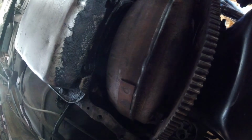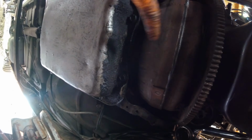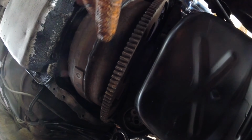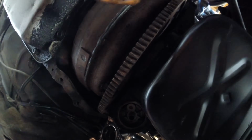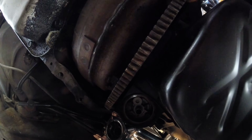Okay, so if you haven't seen an automatic transmission, this is the transmission. Here's the engine. This is part of the transmission, torque converter. And this is the automatic engine flywheel plate. I forget the actual name of it, but you see I bolt one there and it comes to here on the torque converter, one there and then here, and then I'll just rotate it. You always got to make sure you rotate clockwise, so I'm going to rotate this to the right so the engine rotates the correct way, and then I'm going to get the third one. Sometimes they have 4, this one's just 3, and I tightened those. I didn't torque them completely, they're real snug, and then I'm going to torque them and come back around, and they have thread locker too, so I'm on a time crunch.